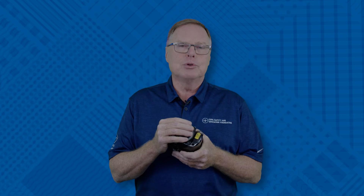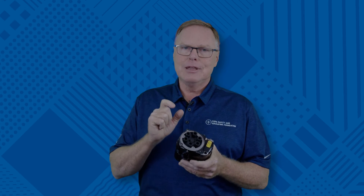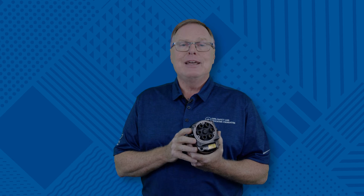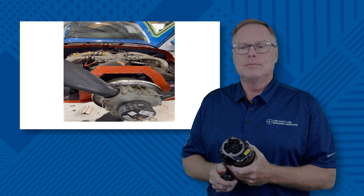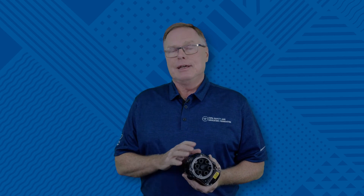You can pull it through just barely by hand. I've got a little short video just so you can see how slow the propeller turns when the impulse coupling clicks — it's actually two clicks because we have two magnetos. If you ever hear this sound, you'll know that you just turned the propeller in the wrong direction. Just barely turned it — that's all it takes to start the engine. One or two spark plugs could have fired. There's always air, there's always fuel in a cylinder. All you have to do is add the third component, which is a spark, and that blade will turn right over. The engine may not start, but it only has to fire once to do some serious physical damage.